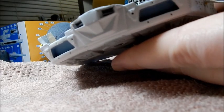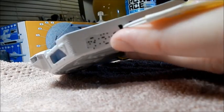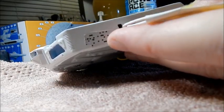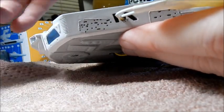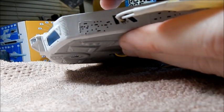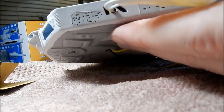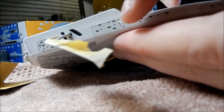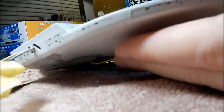We have all our masks off, and as you can see, the back turned out pretty well. But we do have the sides here. You can see not only is there a color difference, but there's also a little bit of edge there on the paint. So I'm going to go back in with this 1000th grit, and I'm going to wet sand that, and I'm going to sand it all down, smooth it all out, and then have to repaint just this edge in here where you can see that clear line where the paint got a little bit too heavy.